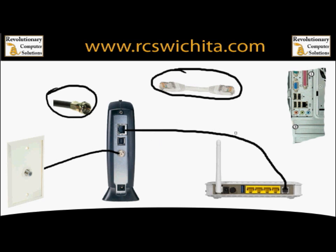So the ethernet cable goes from the modem out to the WAN or Internet port on the router. Then we can use any one of the four LAN ports — one, two, three, or four, they're all the same — and we're going to run another ethernet cable from one of those to the back of your computer. Almost every computer is going to have that ethernet port, and it uses the same type of cable.